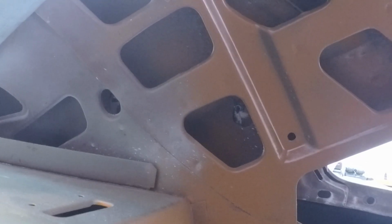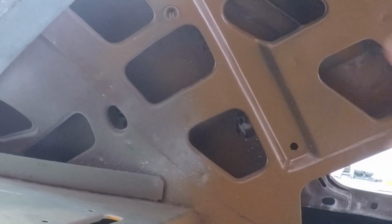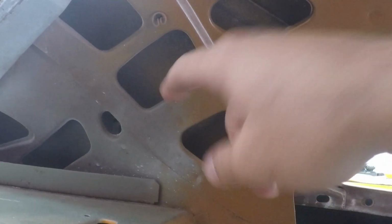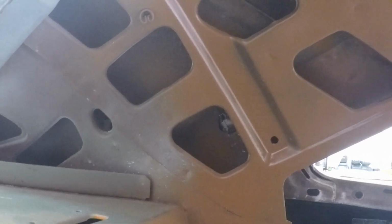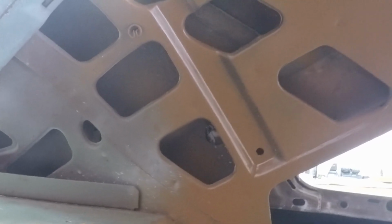Okay, so those speed nuts are all tightened up. Got a little dab of the weather strip on there just in case. Didn't go too crazy with it. Those studs on the emblem are very close to the outside of the emblem. So if you put too much on it, it will kind of squish out and you'll see it on the outside of the car. So just a little bit on the inside around those studs, snug those up. It made a nice little seal in there, and the emblem is nice and tight. We'll show you that on the outside now. Okay, so both sail panel emblems are installed on both sides.